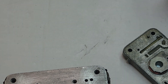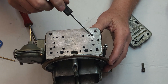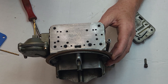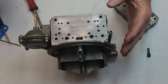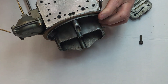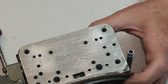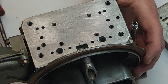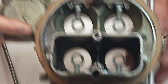You just have it level with the top and it stops it just that quick. Now that's going to give us our four-corner idle circuit. When drilling these holes, you'll be better off if you center punch them carefully with that gasket, and if you've got a drill press, do it on a drill press. Take your time, mock everything up, and drill through there nice and smooth so you come through both sides. Look at it carefully because it doesn't line up absolutely perfect — this idle hole and this one don't line up perfect. It kind of comes in at a slight angle. Take your time because you don't have a second shot at this.